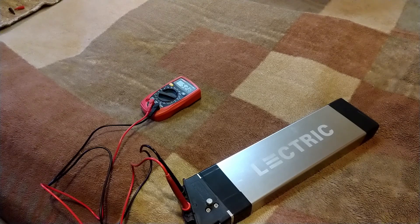If you base that ratio — 54.6 to 54.7 volts full, and 43 volts as your cutoff — you can find a middle ground, give or take half a volt to one volt depending on your battery type. For my 10 amp hour battery, about 48 volts leaves me around a 50% battery charge, based on almost two years of personal experience. If you've gone ten miles and you're down to 48 volts, you are not going to get another ten miles before the bike shuts off.